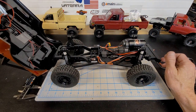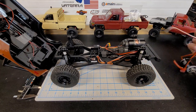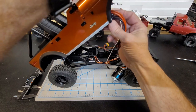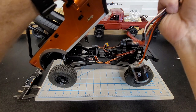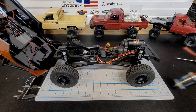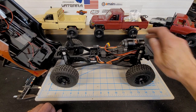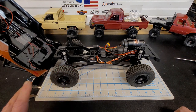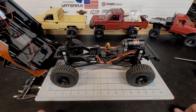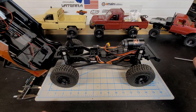Your battery goes in here, which is pretty nice — you can get to it. But when I got this truck, the ESC was mounted to the firewall. I get it, I understand — there's no room, no place to put it — but you couldn't even get the body up far enough to get your battery in. So if there was ever a ready-to-run truck that deserves the HobbyWing Fusion, this is it. The HobbyWing Fusion is a fantastic setup, the SC is just as good — super good low-speed control, just an all-around good system. So I installed that and it works great.